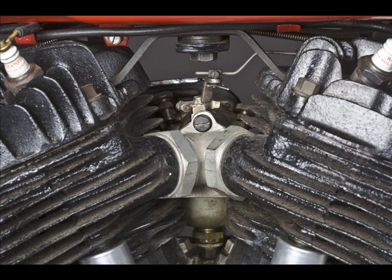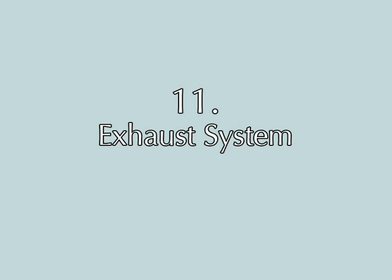On the right hand side of the bike we can see the inlet manifold. This is the VL one in cadmium, which has the casting number underneath, 503-33. These slotted parkerized manifold screws probably came out in the middle of 1935, having previously been plain and cadmium plated.